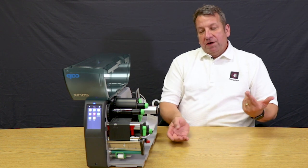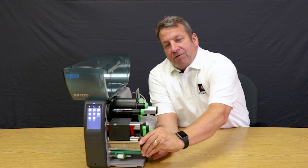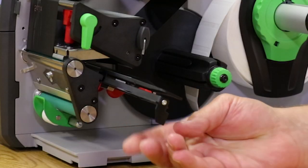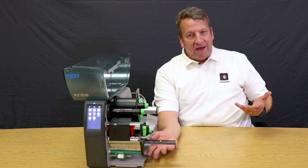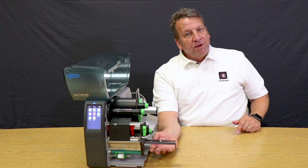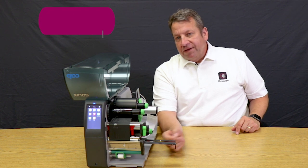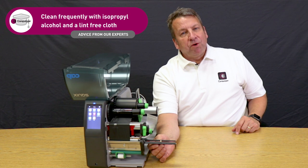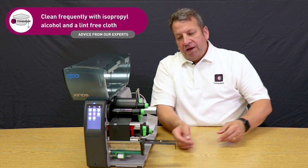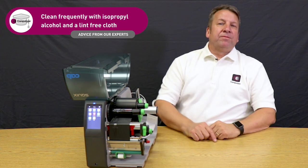What I really like about this printer is that you're able to remove the label sensor in case a label gets stuck or you have adhesive buildup on your media sensor causing it to skip labels. You can remove it, clean it with isopropyl alcohol, reinsert the sensor, and you're back in business printing.